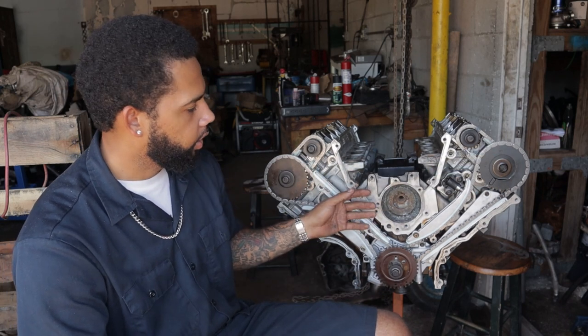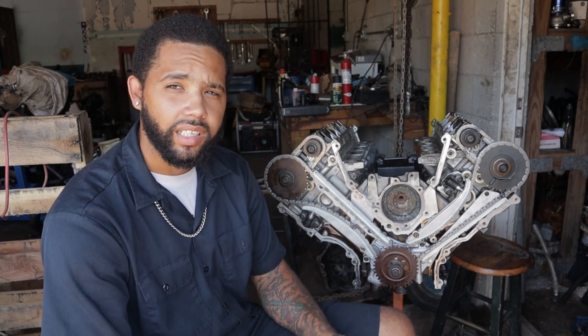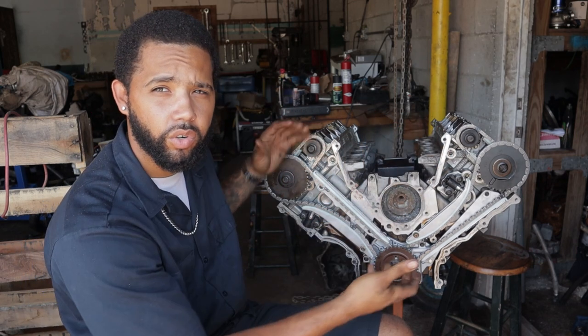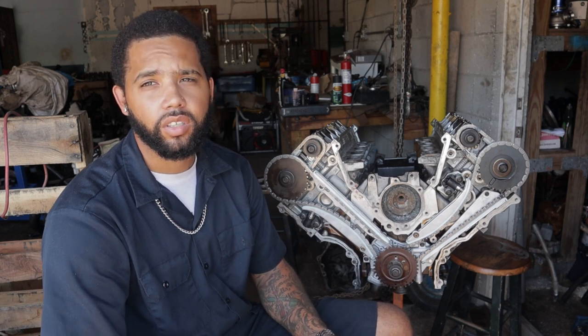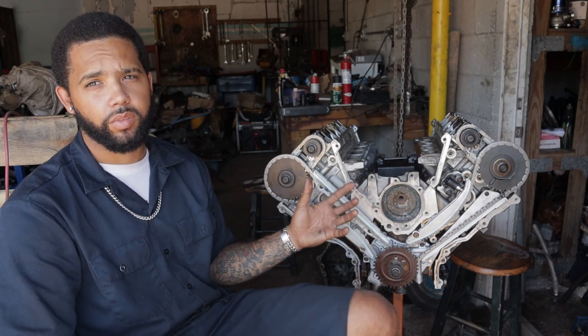So we just completed refreshing this motor. Hopefully in the next video, I can have all of the stuff to close the motor up painted. That way we can put it on the ground, put a gearbox on it, and spin it with the starter, and compression test it to make sure that we have proper compression long before we put this thing in the car. But let me give you guys a close-up shot of the motor.